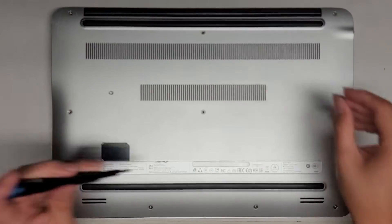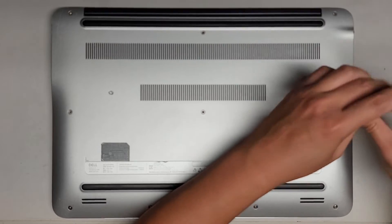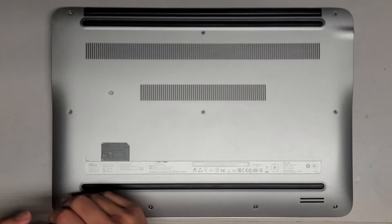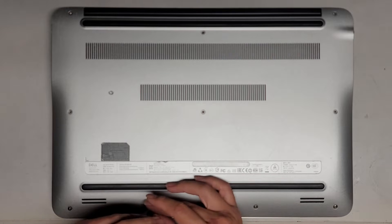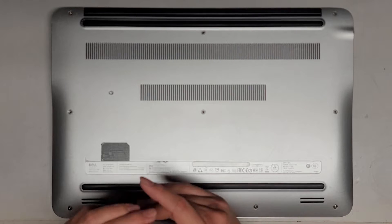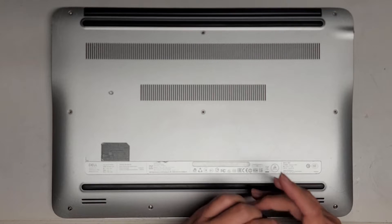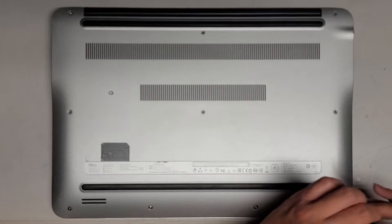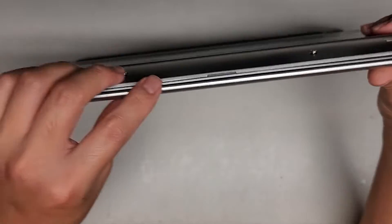So we're just going to get all these screws out — very simple. The reason why we're opening up this laptop is the customer's charge port is broken. It looks like the bottom screws down here where the screen opens actually hold themselves in place, which is by design so that it creates a little gap here to pop open the cover.